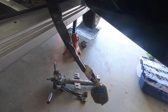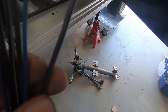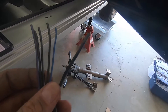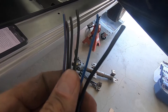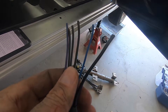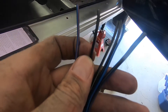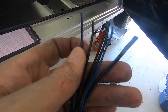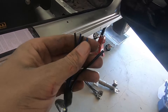Okay, so this is our ignition harness here. We've got six wires. Obviously your big thick one here — a blue-black with a blue trace — that's constant power to the ignition. Next we have our blue which is our ignition, and this one is black-yellow. Then there's also a black-red — that one there is to our starter motor. A black-white is another ignition. And then a blue-and-red is also going to accessories. So it's three to accessories, two to the starter, and one constant power.